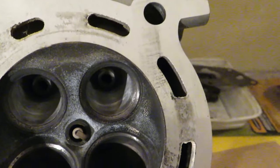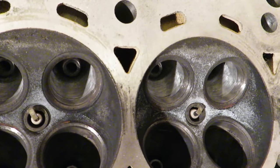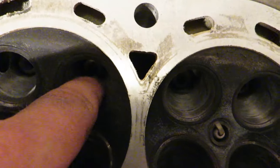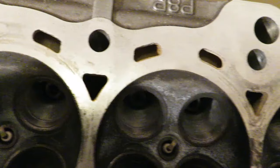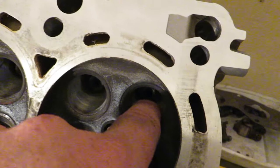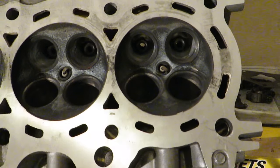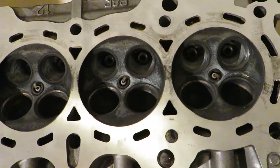About another 30 minutes in — I'll just do intervals so I don't waste your time. This is what the ports are looking like so far. Basically just been blending the valve seat right into the bowl — it's nice and smooth. This is still the 80 grit. There's still a little pocket you can feel with your finger, like a dent in body work. This one has a real bad ridge still. The intake has plenty of flow with the VTEC-size valves — all you'll need to do on the intake is just clean up the bowls.